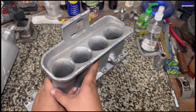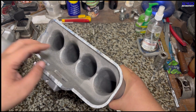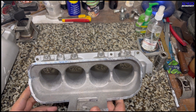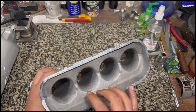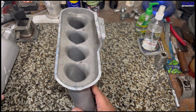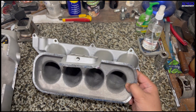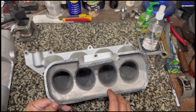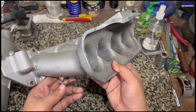This is going to be really, really awesome once we're done porting it. The entry is already tapered, and we can clean up this corner because the walls are quite thick. We're going to flare this just like a velocity stack, so it's always going to be flowing really good. It's roughly around 4 to 5 millimeters thick, which gives us room to expand the entry — flare it up — so it's just like a velocity stack, flowing really efficiently. Even the plenum side that we cut off is quite thick, so we can get it all tapered inward to get the flow speed up into the ports.